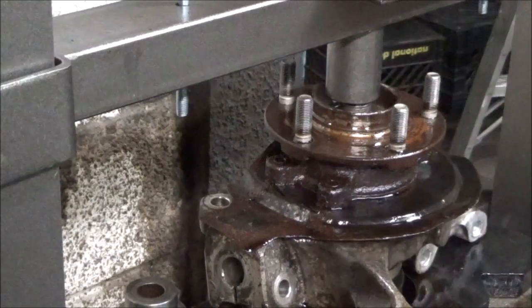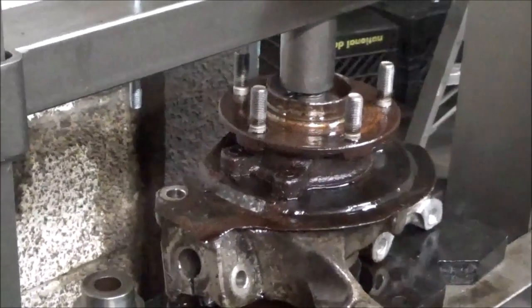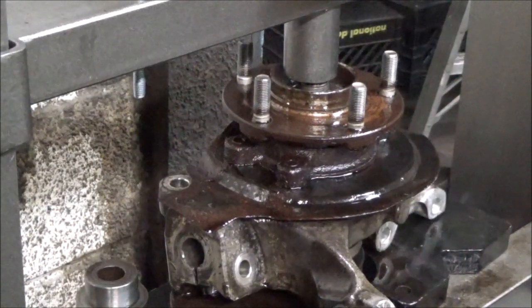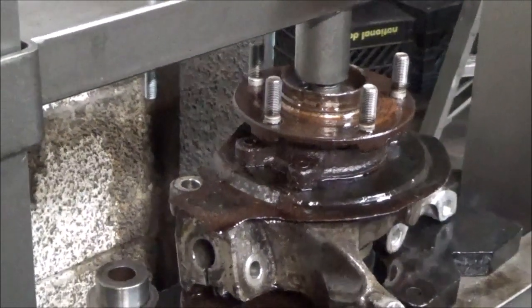What I have here is a spindle and an axle. The axle will not get out of here. We had to take the spindle off — we cut the nub off, part of the actual shaft off, and I have it in the press with some downward pressure. I have soaked it in transmission fluid for about 3 hours and still can't get it out.